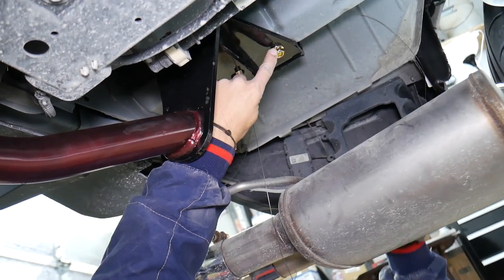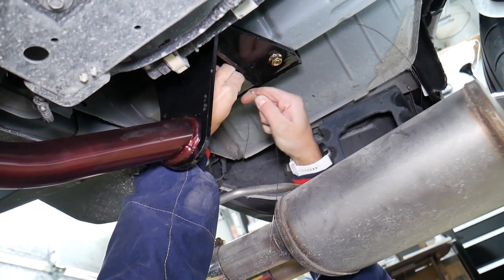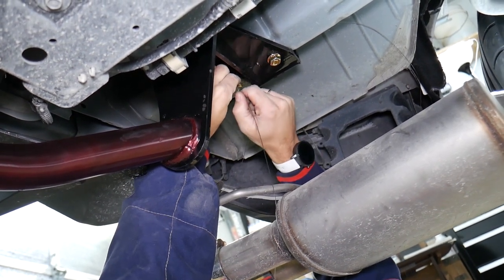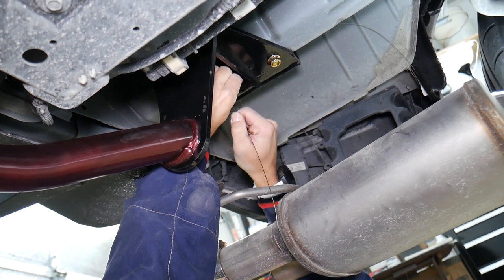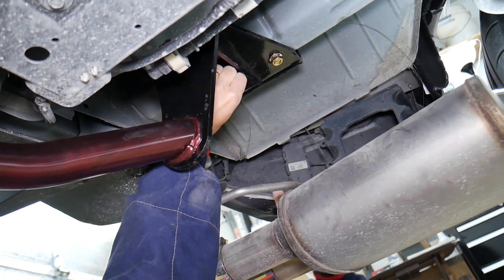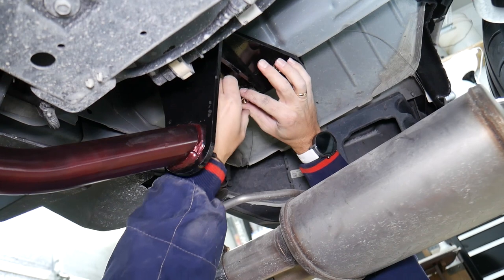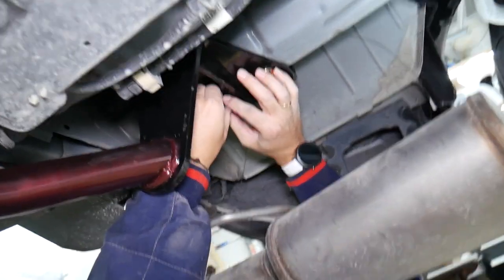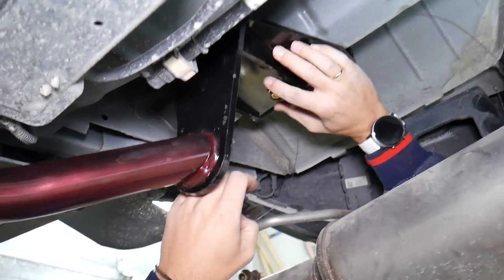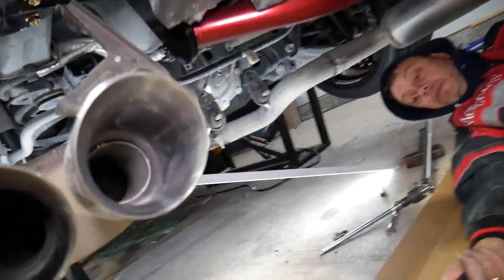We got it in. We installed one nut to show you. Now with the spring, you need to just gently start pulling it out — careful not to pull too much so the bolt doesn't fly back in. Take your time. The spring is out — get the nut. If you push too much the bolt will go in. Just carefully center the nut and catch it by hand, and we need to do that for all eight bolts.